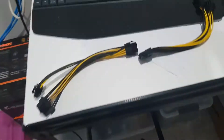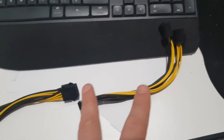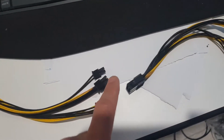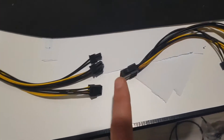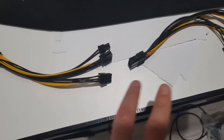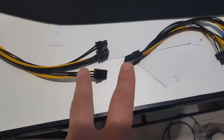Cutting back in — I've had a better look at the cables and I think I'm going to take responsibility here. I actually had two of these splitter cables connected back to back — so coming from the PSU, going into a riser, then joining, and going into the 3060 Ti which needs an 8-pin and a 6-pin. This was a dumb idea. I've seen a couple of guys on YouTube, I think Brandon Coyne, show similar things when building rigs in haste or with a limitation of the right cables.